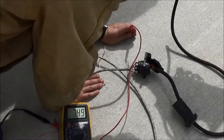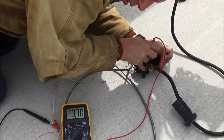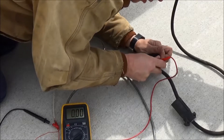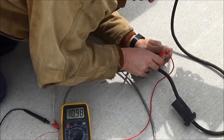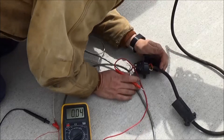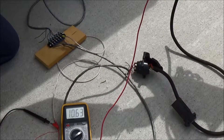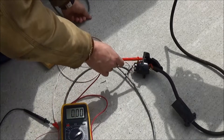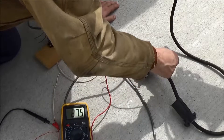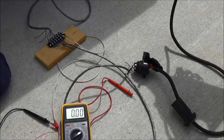Now I'm going to try checking it on the back side of this connector. It's hard to access because the cover is in the way. We got power there, so the question is how come the lights don't work. This should be the ground — but I got 10 volts on my ground wire, and that's bad. I check the actual ground terminal and I got zero volts. So I got 10 volts between ground and ground, which means there's an open ground connection in this connector. Power is going through all the lights and back, but then there's no ground. It's Ohm's law — the voltage drop is across the high resistance point. That's why it doesn't work. There's your problem.